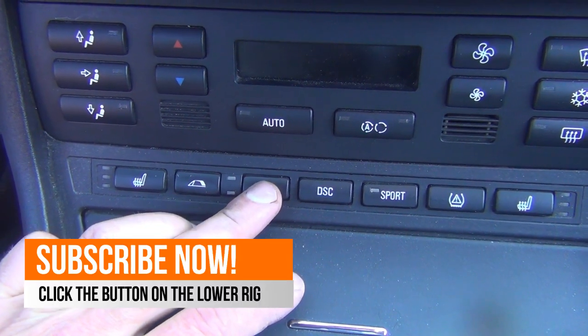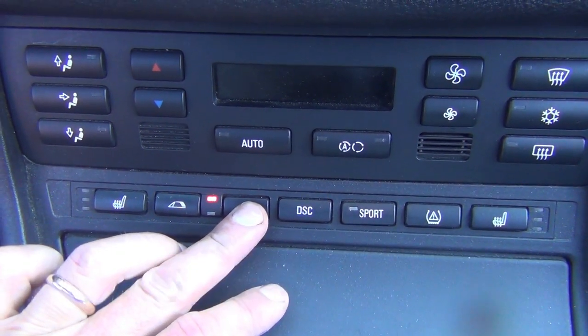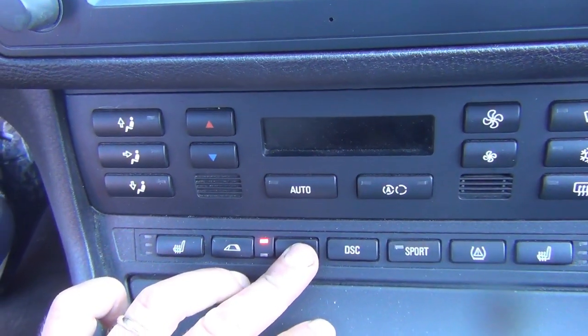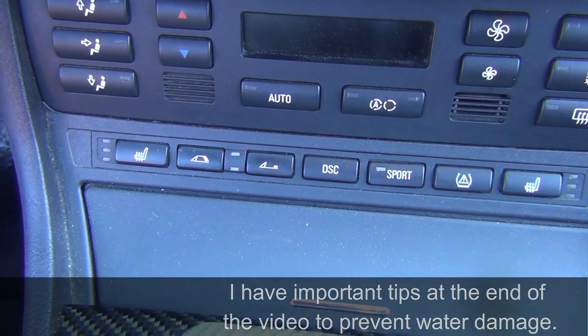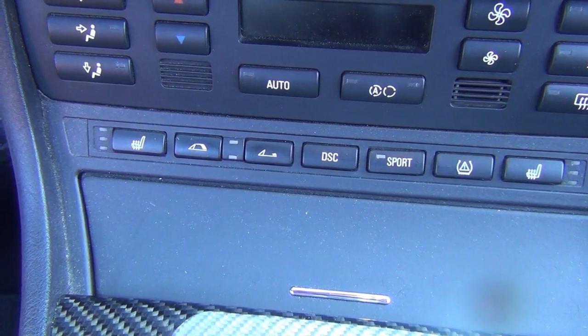In order to do this, I leave the engine running and you open up the top just enough so that the back parcel shelf opens and then you stop. Now if you shut the car off, the system is going to depressurize because it is hydraulic, and then it's going to come down and fall on you. So I usually leave it running.